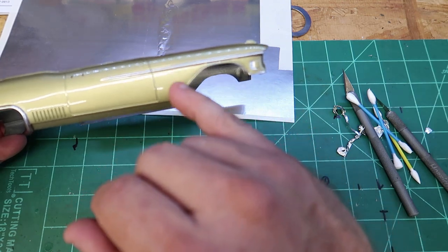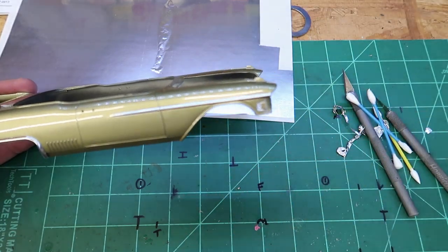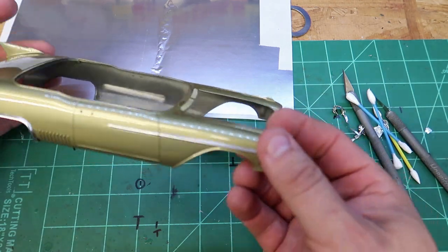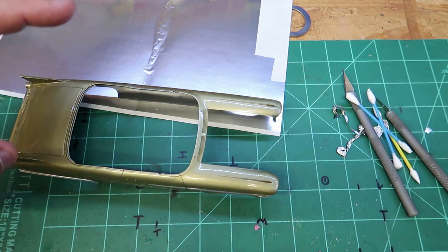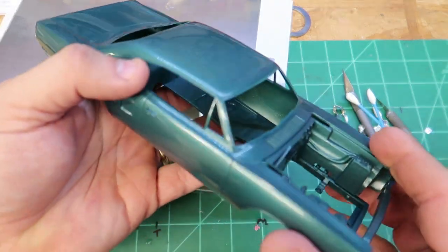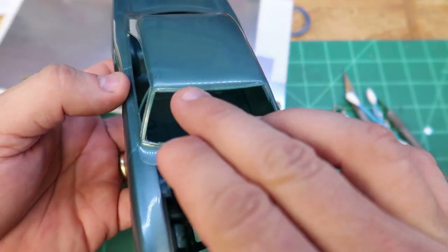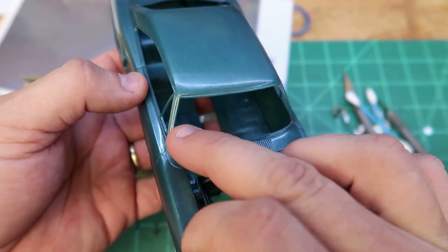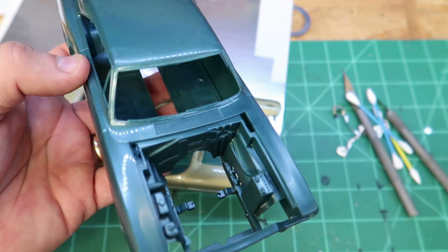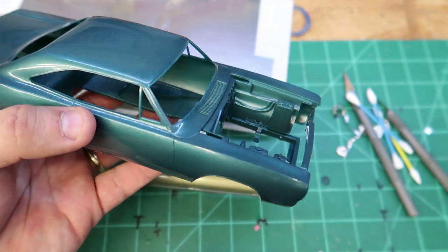This front portion here, you could use strips if you wanted. What I find with strips, and this is another reason that I like to use single pieces, especially on a windshield, is when you have a windshield. Do I have a car? Oh, I do. Let me borrow this for just an instant. This just happens to be a 1970 GTX. So when you lay it on your windshield, some people put a strip here, strip here, strip here, strip here. Those strips overlap. And what I found, at least with me doing it, is I can see the overlapping foil.